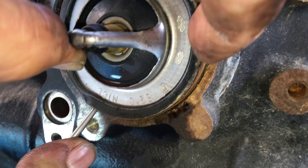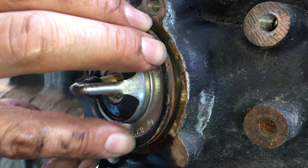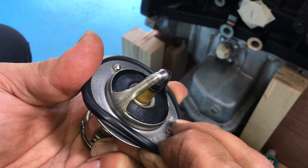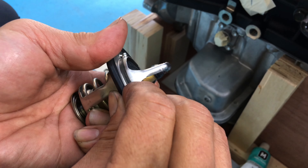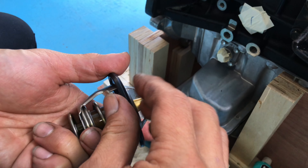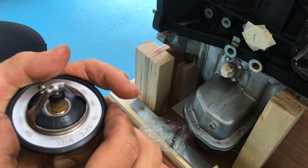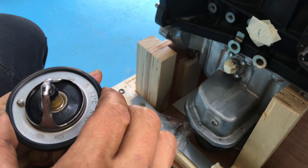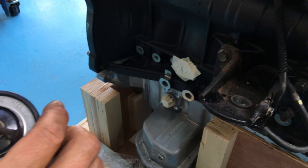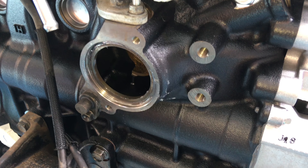See what it says? 82 degrees. And you'll see about 93 on your scan tool at idle. That's quite sticky. It's not 92 - it's 82. This is a 1KD, not like the old days of old Fords back in the 90s where anything over 100 you were cooking it. So 82 it says on the thermostat - that's when it opens. And on your scan tool you'll see 93, but the time the coolant gets from this point in the engine around to where the sensor is on the front of the head - that's what you see basically.